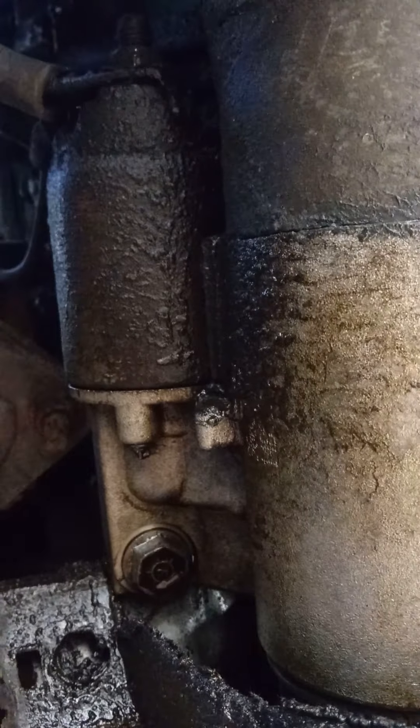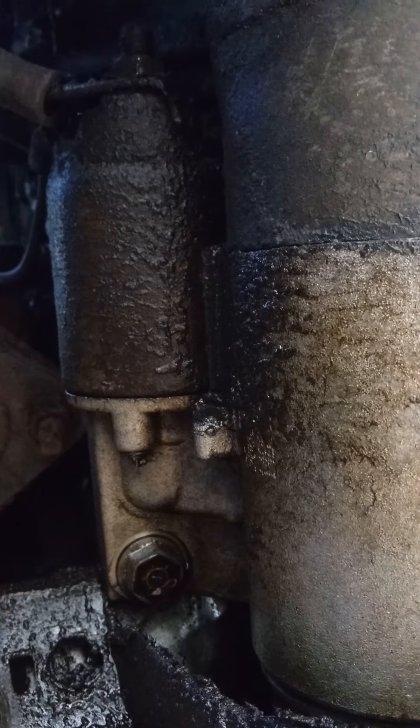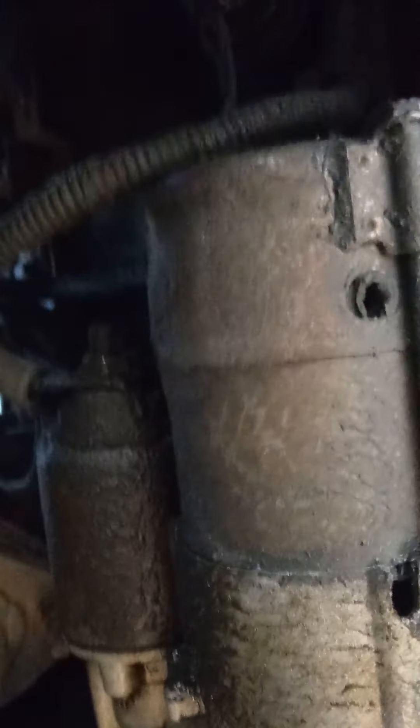Mobile Car Doctor here, and we're gonna go underneath the Impala. We're going straight underneath the passenger side — oh, look at that, there's your starter. You see all that oil coming through it and all around it? That's because there's an oil leak, and this is why we're changing the starter — it has malfunctioned inside and just winds up and spins out.